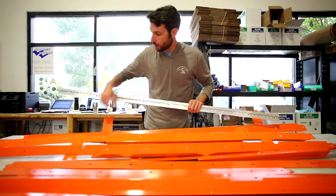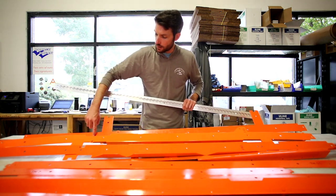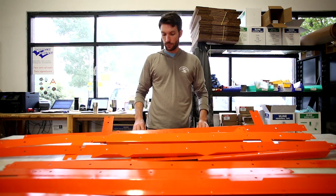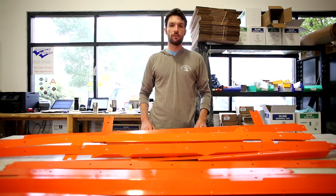When you get to this part of the install and get your track out, all of these holes — whether it's a hole for a rivnut that you'll set in the van or these cinch nuts — that's what you're bolting the track down to. The track is reinforced by the A-frame, and then the track is also flanged to hold the panel kit. This truly is the skeleton of the entire kit.